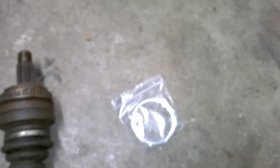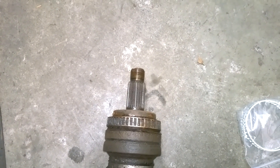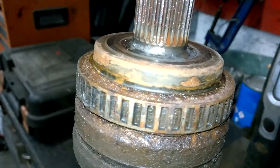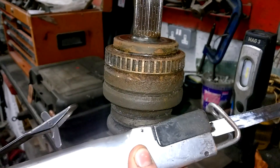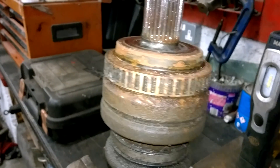I have my new ring here. I'm going to put the shaft in the vice and press or cut off the old ring — either way, as long as you don't damage the surface underneath. I tried for a couple of minutes to lift it off the seat with pry bars and screwdrivers but it's just not budging, so I'm going to use an air hacksaw. I'm going to make a sideways cut — being careful not to go too far and damage the seat underneath — just cut enough so it breaks through and I can pop it off.